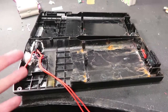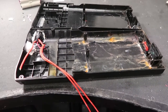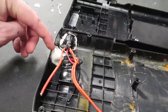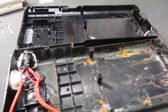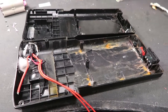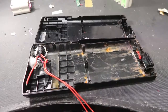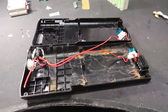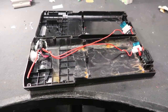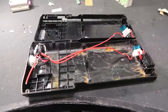In most cases, water damage like this takes several years to build up, and then you have to buy a new battery — even though it's the manufacturer and reseller that are the biggest problem. They chose not to add a rubber seal or silicone seal at that port, so all of their customers will have to buy a new battery in one to two years. It's planned obsolescence at work. The worst thing is the importers don't even know about this — they don't bother looking inside the battery. I get so mad at resellers and importers that don't even check the goods or open the batteries once. That's so common in the e-bike business — you never know what you're getting.